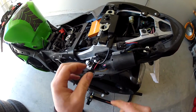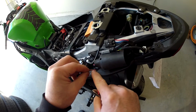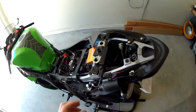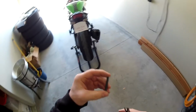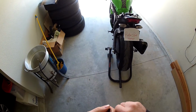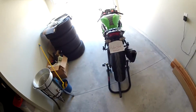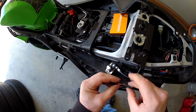Alright, so now I've got my wires stripped, guys. You can see right there. And I'm going to put a third one in there. The reason I'm going to do it the way I'm going to do it is because I'm going to use the shrink wrap, guys. I'll have to dig around and I'll put it in the description on where you can find it. When you heat the shrink wrap up, it's got a coating inside it that'll basically seal the wiring and keep any moisture out of it.